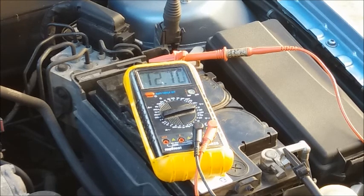The battery will give its best when it's at least 70% charged all of the time. If a battery is allowed to discharge regularly or consistently, a sort of memory effect takes place and the battery will deteriorate inside. It'll reach a point where it won't take much charge anymore, and come winter the battery will die because of the cold and the strain put on it from starting an engine in the cold.